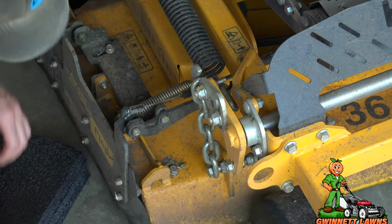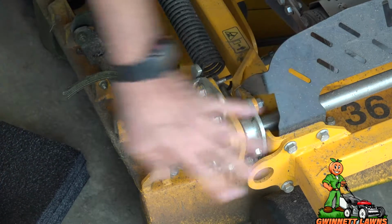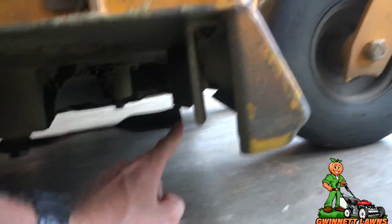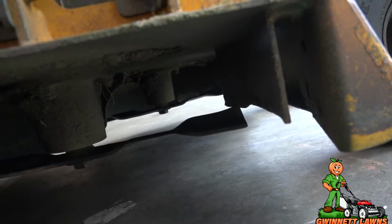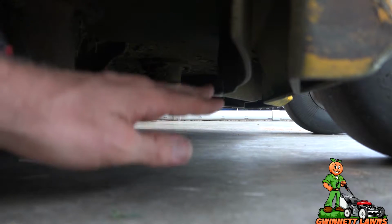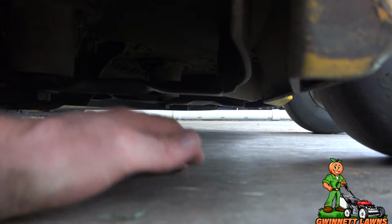All right, so what I'm going to do is show you a shot of this. Well, let me see if I can do it like this with the camera. It's going to be kind of hokey. So we know the tip of the front blade had the blade going forward to back. I'm just going to lay this here. We know that the front tip of the front blade, right here, the cutting surface should be 3 inches. So I'm going to take my 3-inch gauge,